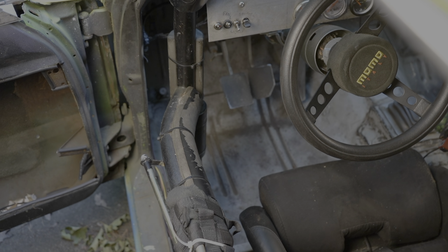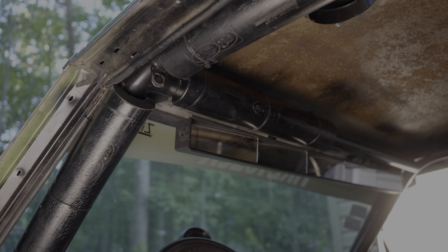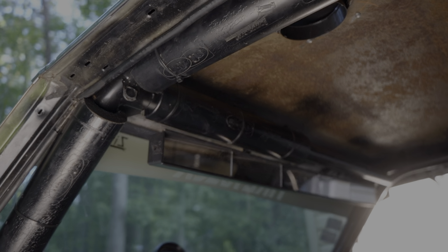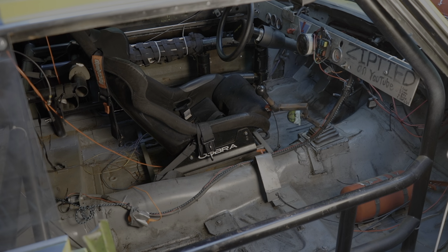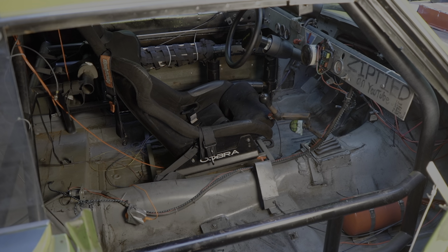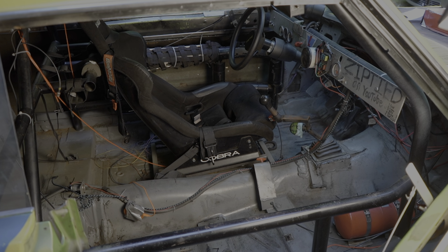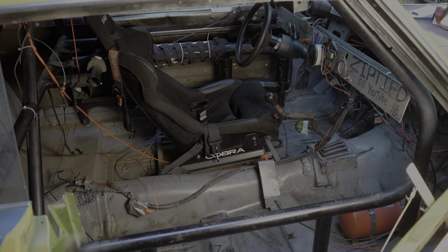The roll cage needs padding anywhere the driver could hit belted down. Don't buy pool noodles because they don't help in a 60G accident and they also melt in a fire. The interior also needs a general de-scuzz. Vacuuming up loose objects, covering sharp edges near the driver, and zip tying wires. While you're at it, make sure there are no holes in the floor or the firewall.